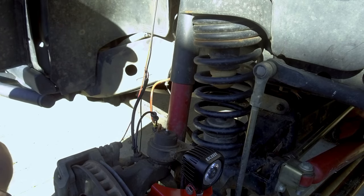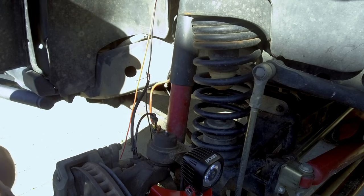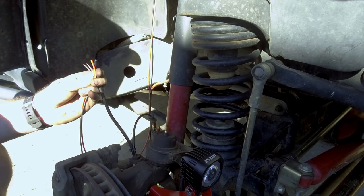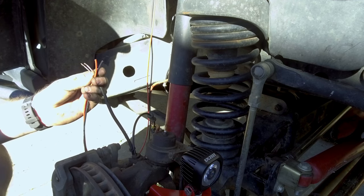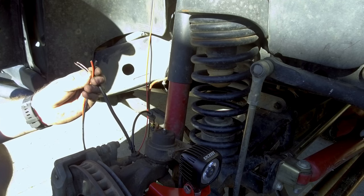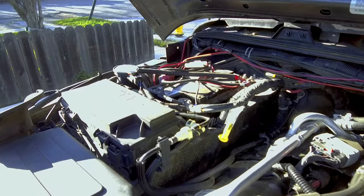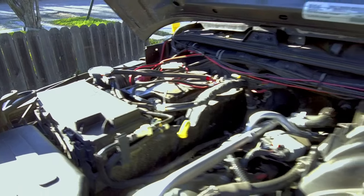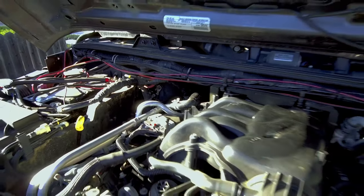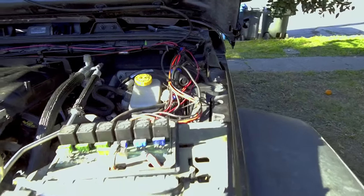You're going to need some wire strippers. I like to use butt connectors with heat shrink — that way it gets a good solid connection when you're joining two different wires and the heat shrink will create a watertight seal around it. Anytime that you're dealing with electricity, water is a bad thing. After you get the wire connected on the passenger side, I like to run it along the back tubing over here. Then you can come in here and wire it to the S-pod.